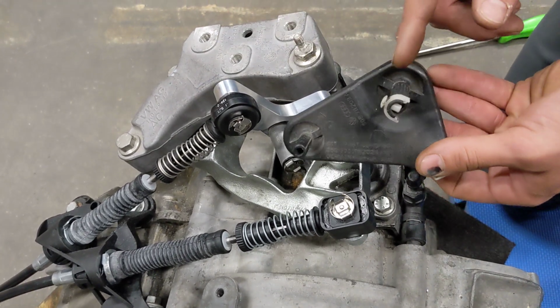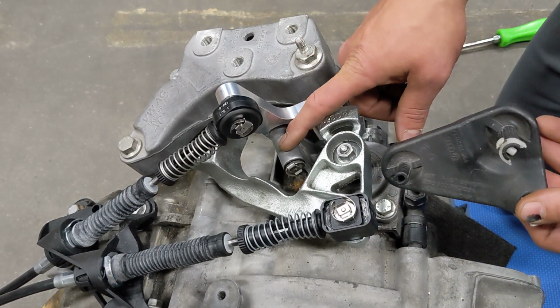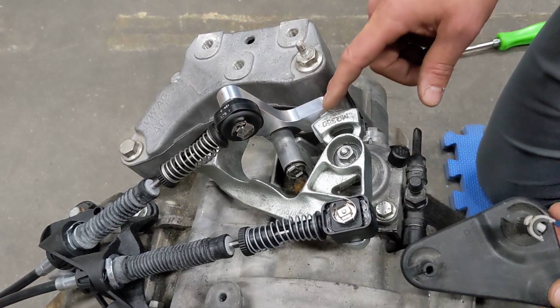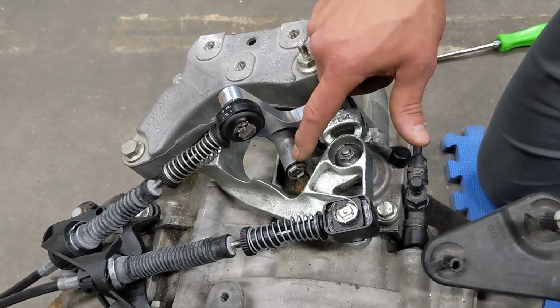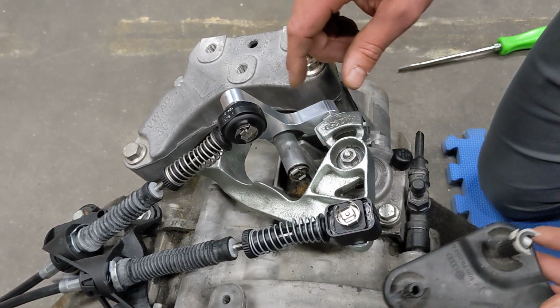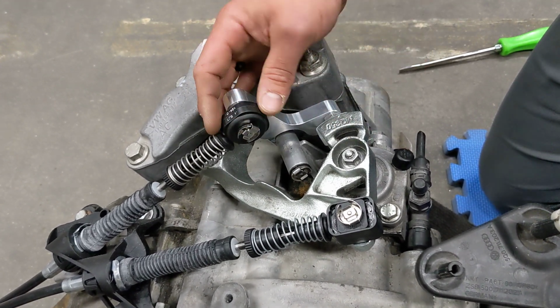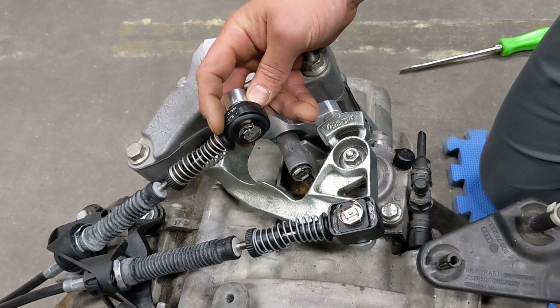Instead of the pivot tube riding directly in the transmission housing, with no bushings and loose tolerances, we use a stainless steel pivot pin here with the same bushings we use on our Sigma Shift kits. We also include a pair of perfect pivot bushings, which eliminate all of the end float out of the side-to-side cable end.